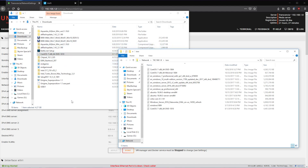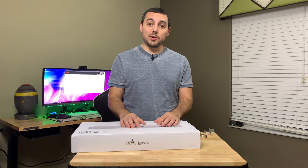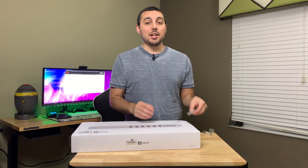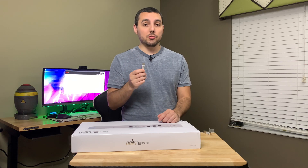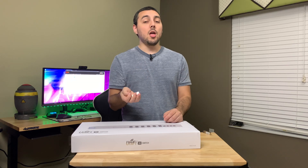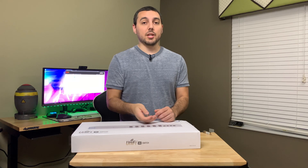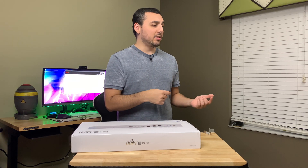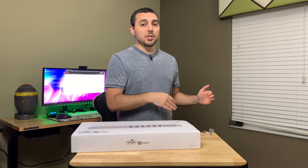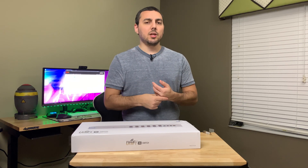Wow, that was pretty painless and very straightforward. I did a little bit of research this time and found out that you could use the SFP Plus modules. I am using SFP modules, not SFP Plus, but you could use an SFP Plus module — you would have to turn the auto-negotiation to manual mode and set that to 1,000 megabits per second on both ends for it to work. In my case I think I only needed to do the XG side — set auto-negotiation to manual mode and 1,000 megabits per second — and it probably would have worked, but I did both sides anyway.